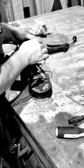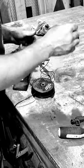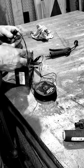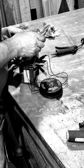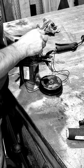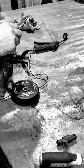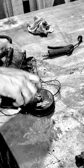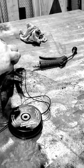The injector is not polarity sensitive. It does not care what's positive or negative. Go ahead and hook it up randomly. You can see every time I trigger it, we're getting some flow. And that stuff looks pretty nasty. Too bad this isn't in color.